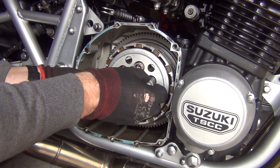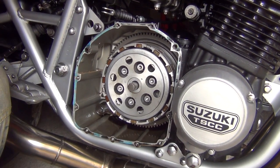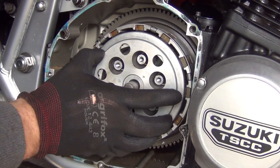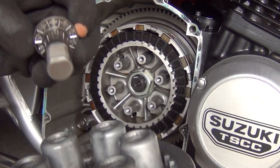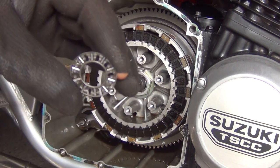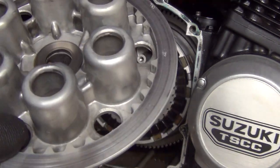Remove all of them — that way you'll be able to remove your pressure plate. Just don't forget you've got this bit here with needle bearings. Don't lose it. Those are your needle bearings, so inspect them — they seem to be in lovely condition. And also you've got this piece here, this washer, so don't lose it too.